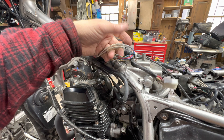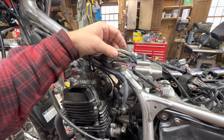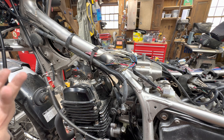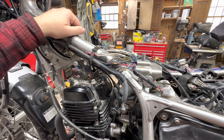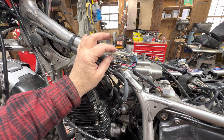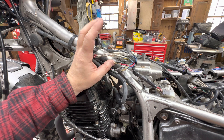So what I'm going to do is what I've done for the rest of them, which is replace them with Japanese motorcycle style waterproof bullet connectors. These are another thing I bought from cycleterminal.com — not a sponsor — but they sell them in quantities of 25, 50, or 100, both male and female ends, and they come with the insulating jackets. Good quality, they work really well. You could probably find them on Amazon too. Yamaha uses the 3.9 millimeter bullet, which is what these are. They also make a 3.5 millimeter that some Hondas use, but Yamaha uses the 3.9. So if you're going to buy some, get the 3.9.